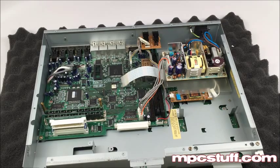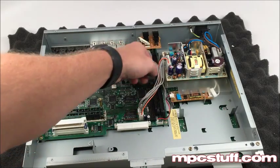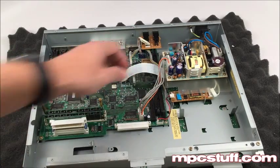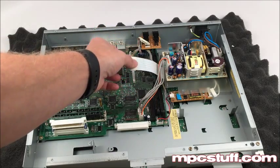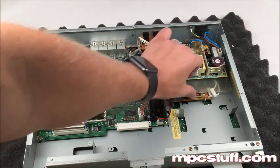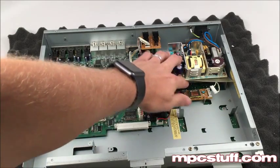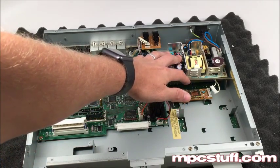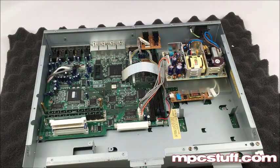Now we're going to go in, and since we have both parts for the LCD window undone, we'll be all right. Keep in mind it's hard to get out right here. Being that we're replacing this cable, it's not as big of a deal because you can scratch the cable if you have to. But you'll notice underneath here, if you look — I can't really get my camera at it — you're going to see that there's a zip tie holding it in. I'm going to show you that zip tie because it's going to be best if you can cut that zip tie before you try to pull through. It's just going to make everything easier.